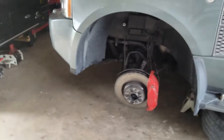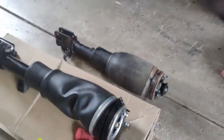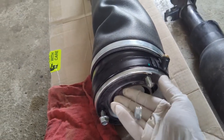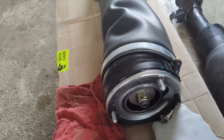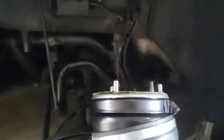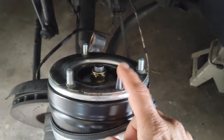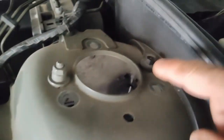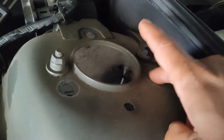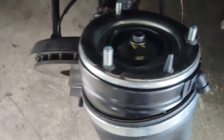We're ready to put the strut back in the vehicle. The first thing to do is hang it and make the airline connection, then push the strut back into the tower and put the top screws on to hold it, then assemble from the bottom. I'll reuse the original top nuts since they have a better washer. When putting the strut back in, get it in the correct orientation — there is a guide pin on top that aligns with the strut tower, and once that pin is seated the three studs will come through.